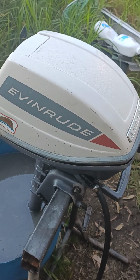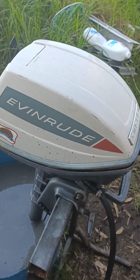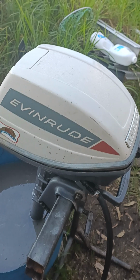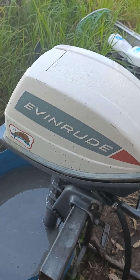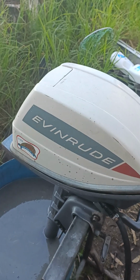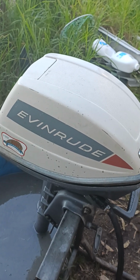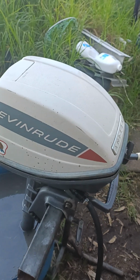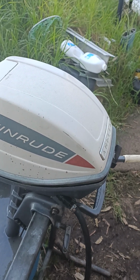It's not easy to find these days, because most of the leads these days are suppression leads for radios and stereos and everything in cars, which are all carbon trace. But these old motors need copper cable, and that's best for the magnetos too. Yeah, I did a really good job on it.